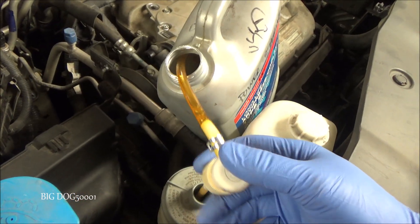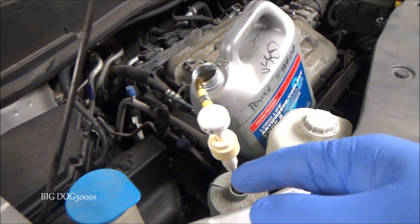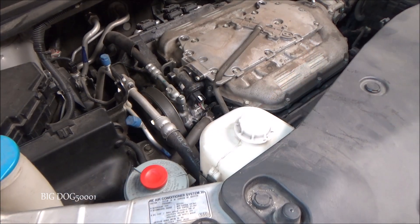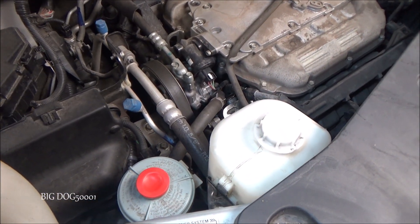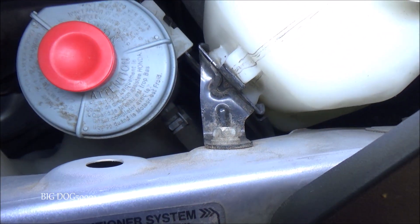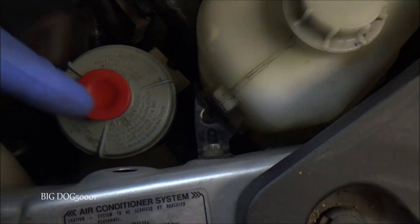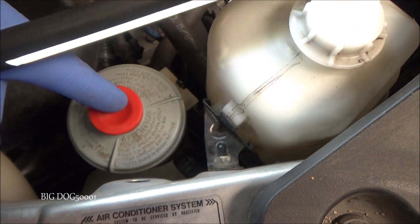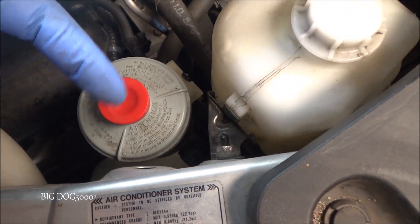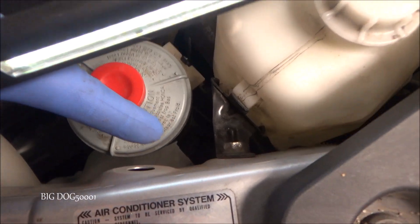That looks like about it. While I'm thinking of it, we want to keep this power steering fluid off the belts and everything else as best we can. Before I replace the pump, I want to get the old power steering fluid out — or at least as much as I can within reason. So I'm going to pump it out using the pump itself. To do that, I'm going to disconnect that line that's coming into our reservoir, and we'll have to adapt to it so we can pump it out. First we've got to get this reservoir up out of its bracket so we can get to that little clamp right there.